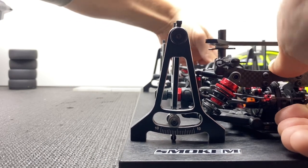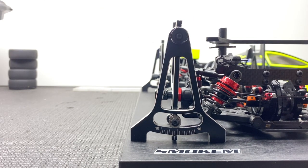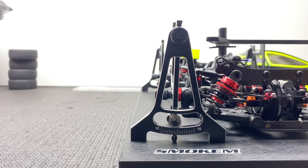Now, what that means is that when the car is in mid-corner going full speed, the tyre is not overloaded. So it's always searching for grip — there's always bite there, and you can get the car to roll. You don't want too much roll obviously, but this helps the car. You don't want too much camber either — just about 0.5 degrees negative camber is about right. Any more can be a bit taily, and can actually have the same effect as not enough. So you'll find that sweet spot, but definitely negative camber is what you want.